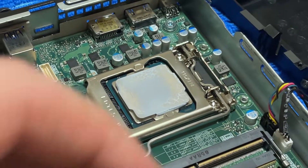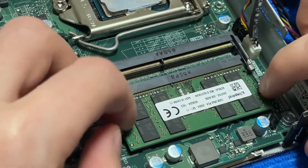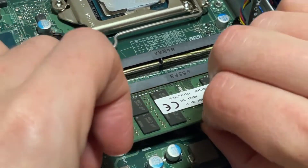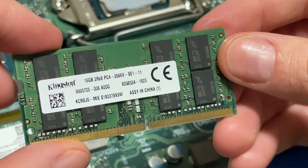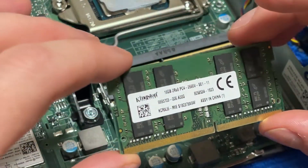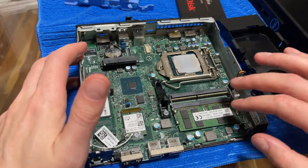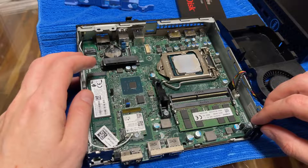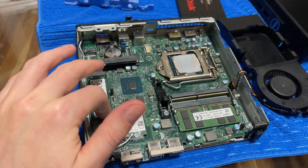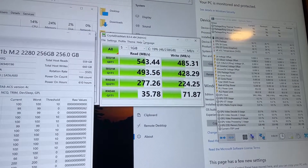It looks like it has a single 16 gigabyte RAM stick in there. Really what you're going to want to do is have this in dual channel, so I would have liked to have seen two 8 gigabyte sticks. With these type of machines where you have integrated graphics, you really do want dual channel RAM — meaning two paired sticks rather than a single stick. It's always more desirable than having one larger capacity stick in an open slot. Performance will be basically the same as any SATA SSD, so 2.5 inch — which is fine. NVMe is going to be quicker especially for booting.